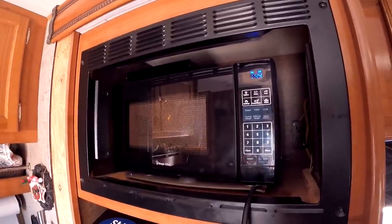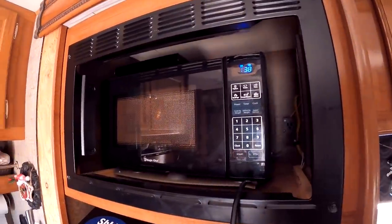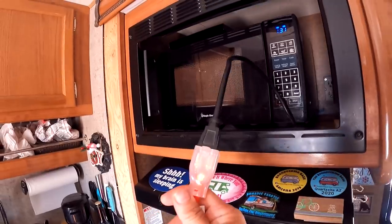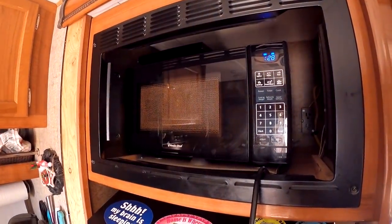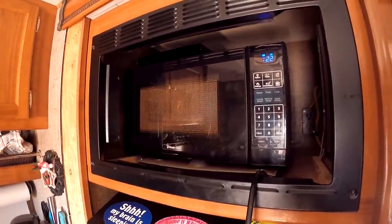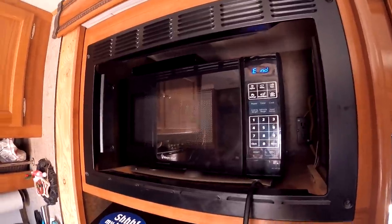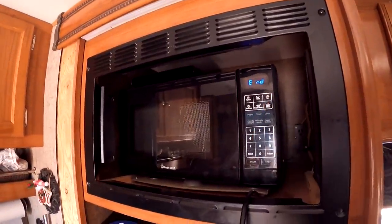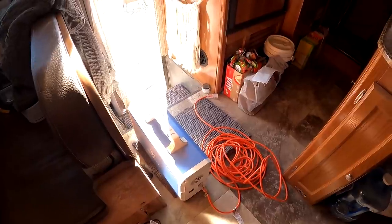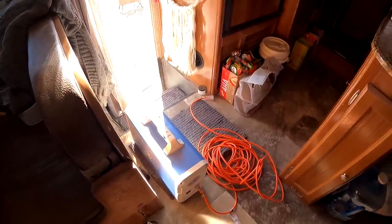Okay, plugged into the RV, and this plugged into the plug back there, it doesn't work. It throws the breaker. But plugged straight in, it does work. Awesome. My other one's 1,000 watt, and it runs this. That's why I have it where I can push it back and get the plug. It ran a full minute pizza reheat cycle, no problem. It definitely can run the microwave. It's just when it's plugged into the RV, there's a lot more going on, so it brings it over its surge point. If you run units by themselves, it seems to work better.